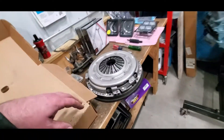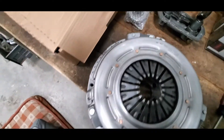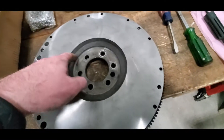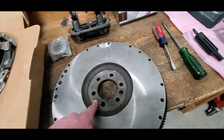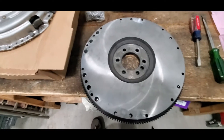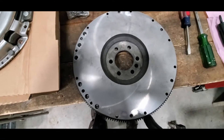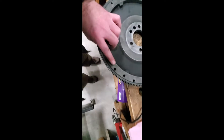Nothing quite as boring as waiting for paint to dry. While we're doing that, I decided I better verify — even though I'd already checked against the old one — that everything lines up fine. The other thing I've got to do is mark this flywheel. I'll probably mark it all around here with my engraver to let the next person know that this is weight balanced to the rotating assembly, and that if you wanted to replace it you'd have to put both on a mandrel 180 out and balance them to each other. I've made notes that it's not standard — it's balanced to the crank.